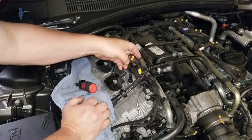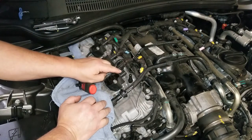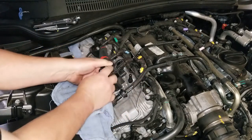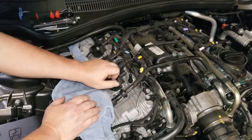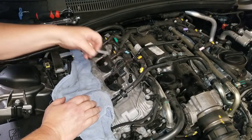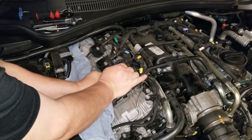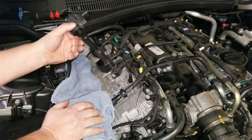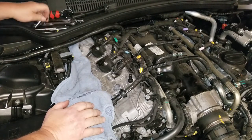I'm going to work without gloves because I'm very fumble-fingered with gloves. So first we undo the screw. Pull this up. There — it comes off like that. Now you pull this yellow thing forward, up, and then push down on this. There's your little catch right there. Now we'll go ahead and undo the Torx screw here. We just kind of pull up on the coil and it pops right up. Put that aside. And we get our socket.